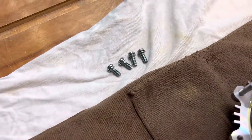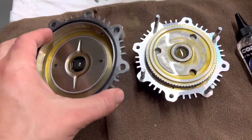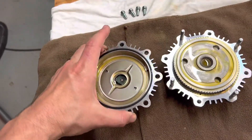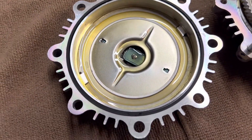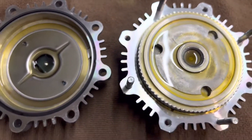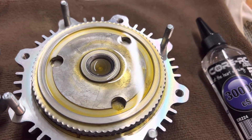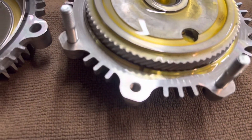Taking this thing apart is no big deal. You just take out these four screws — they're a number three Phillips head. Hit them with an impact driver if you've got one to bust them loose. Mine's brand new, so no wear, no corrosion, and they came right out. The two halves separate pretty easily. There's a flat O-ring type seal in the groove there, and it stayed in place for me. You can see that it seats down in there, and I've got a little bit of fluid coming out from the edge, but it should seal most of it back in. What I did was add the fluid — I basically just filled up the holes and it's kind of level across the top, with a little bit drooping out on the edges, but not too bad.